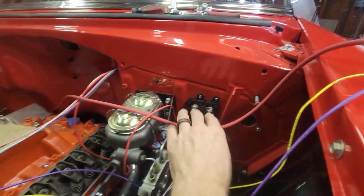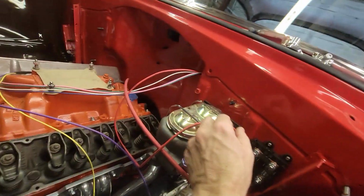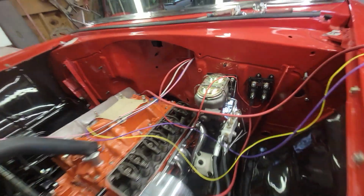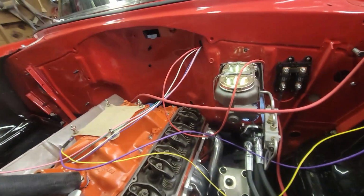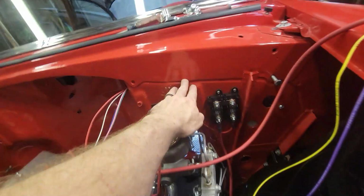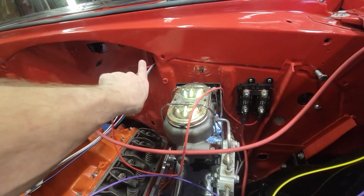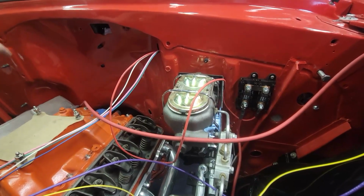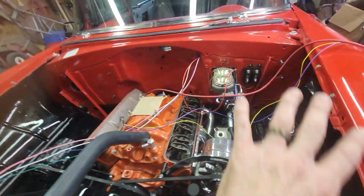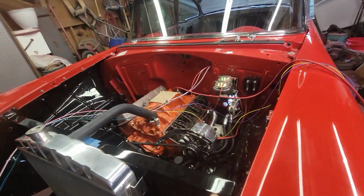So I'm going to have 2 wires that are coming off, and 1 heavy wire that's going to the starter. That comes off of the mega fuse block, and then there's another 10 gauge wire that goes back into the switch. I already talked about that. So what I've decided to do is route these up and then over. I'm going to go right in here, tuck them right in here, and then pick up this set of wires, and continue with some over there towards the starter, drop down next to my battery box. These will come out and they'll be on the top of the engine. So I just need to keep that in mind as I'm routing, as I'm picking wire lengths and trying to figure out how I'm going to interconnect everything.